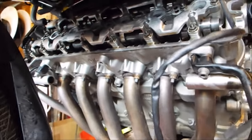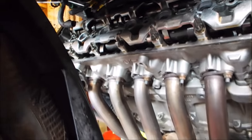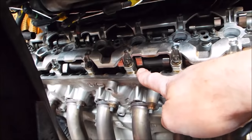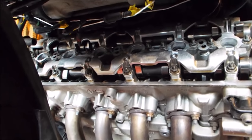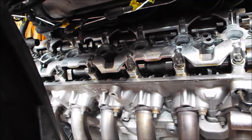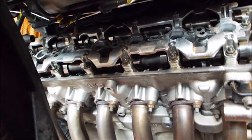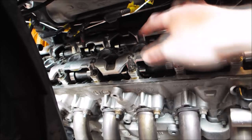We've done five cylinders and the last one is cylinder number four. We're going to turn the crankshaft again using the spanner. Here's number four coming up onto the correct position. Just double checking at the back - yes, that's fine, I can feel the cam in there.